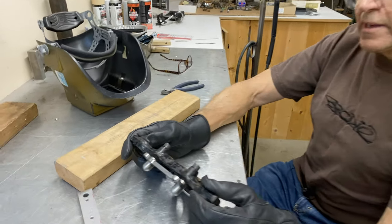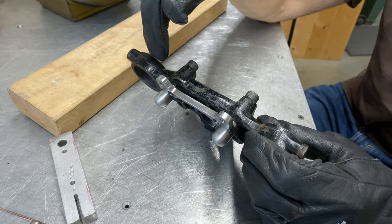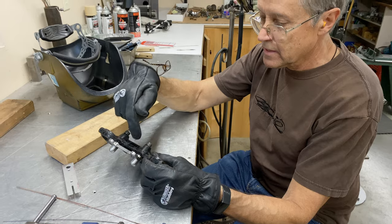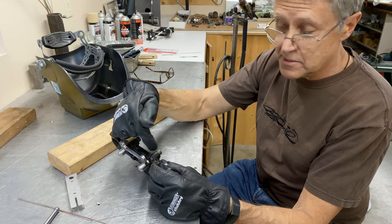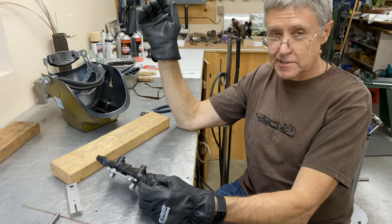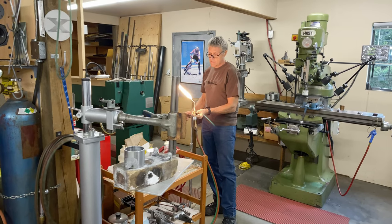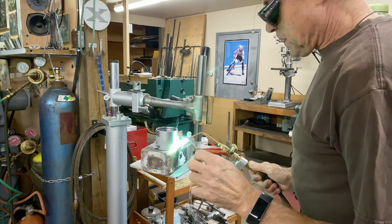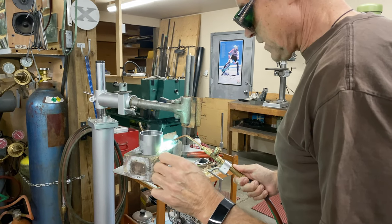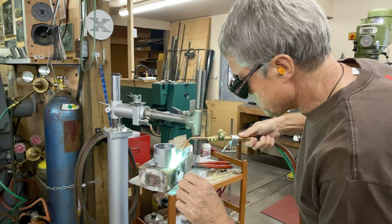That's what it looks like. Everything has to be silver soldered — I forgot to sand this so I'll sand it afterwards. Then we just have to make those little spaces that go in between and it's done, then we're onto the side stand. I could nickel silver this as well, but I just felt like silver soldering — it takes a little less heat and it flows very nicely if everything is right.